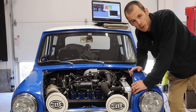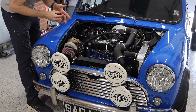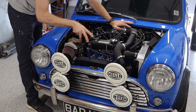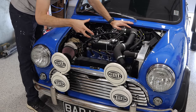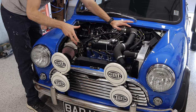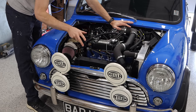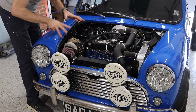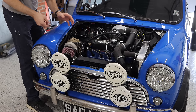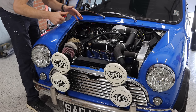Let's try this one more time. I did figure out what the issue was — it was pretty simple, a combination of two things: one, the carb was just a little too rich, and the spark plugs were fouled. This is a perfect example of how sometimes it's really simple stuff causing heartburn when you're building or working on a new engine like this. A brand new set of four spark plugs made this work perfectly after I replaced them — a great thing to keep in mind when you're building something like this.